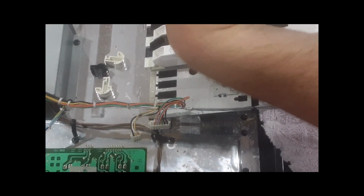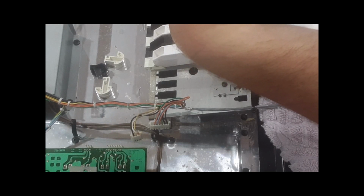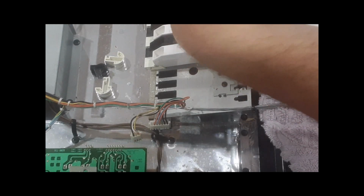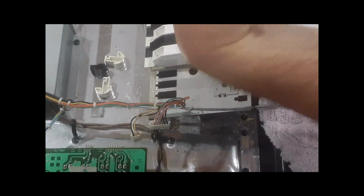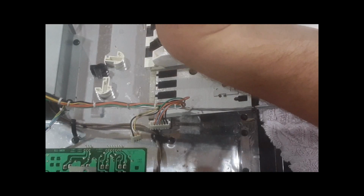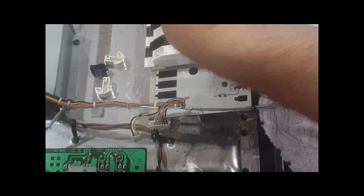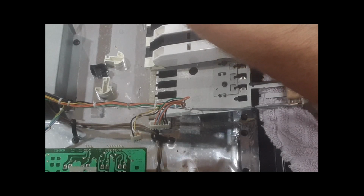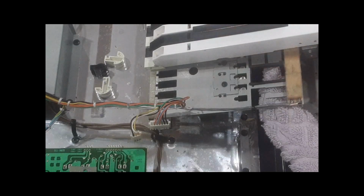When it's up, they call that the break, because as you press the key, it breaks that contact. And then as you press the key down further, it makes the contact. They have a break-make thing. So when the key is up, the switch is up. When you push down on the key, you push down on that switch, and then it makes the connection to the other contact underneath. And that's the make. And by measuring the time it took from here to here, with debounce and all that, the KX88 knows how hard you hit the key, the velocity. Very clever, just using a little switch.